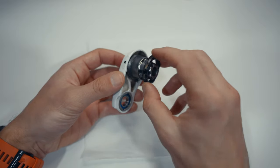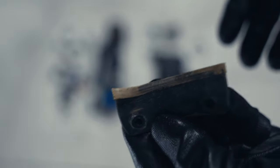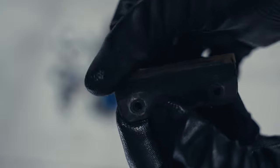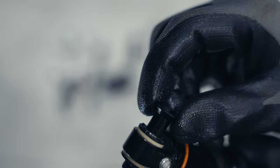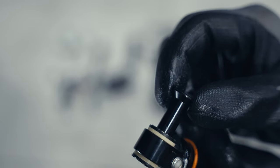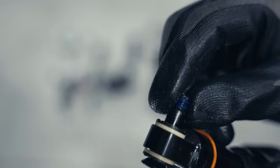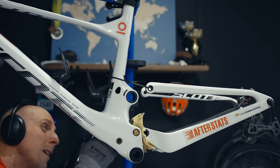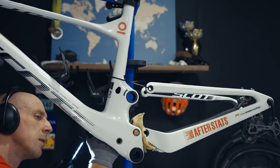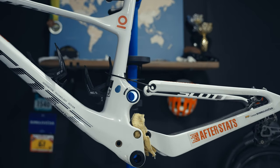The plastic cover which goes on top of the swingarm actually scratches the frame quite a lot, so for that reason I also applied protective tape in the past so two different material objects won't scratch as much. Here I'm showcasing how the movement of the old generation bolt is inside the bushing — it's not major, but I've seen some guys having a lot more play here. Hopefully the new bolt could help a bit, even though that's not the reason it's being replaced.